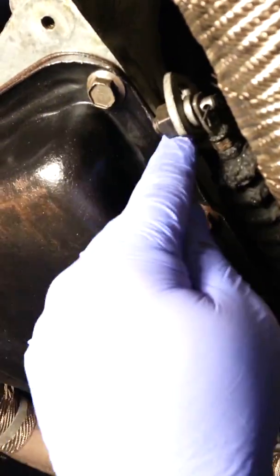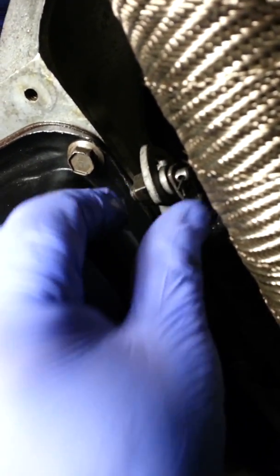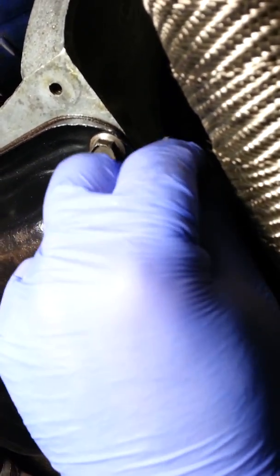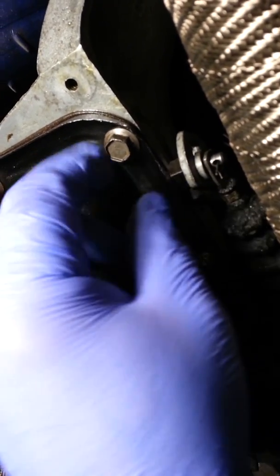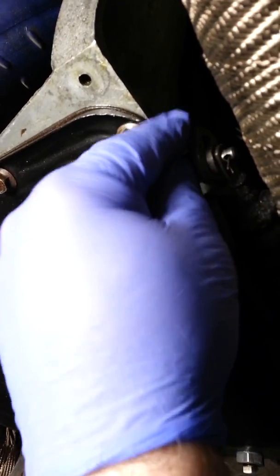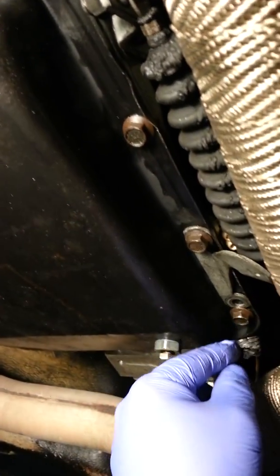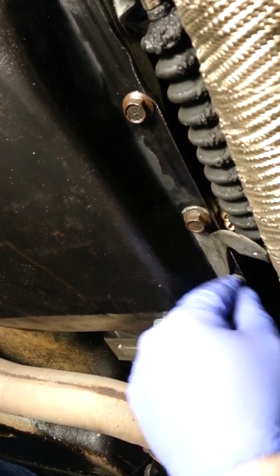You've got the piece up here where the linkage is, and I got a little cotter pin in there for the shifter. There's a bolt right here that's adjustable — you can change the throw a little bit so that if it's not engaging in gear correctly, your console is not going to match up in the center exactly the same, but you'll be able to tell.